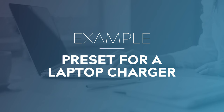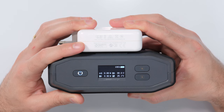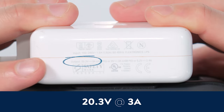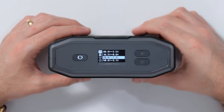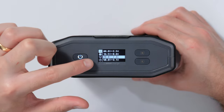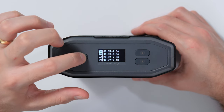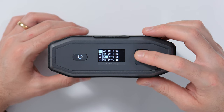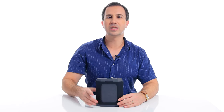Let's say that you have a laptop that you want to set your output for. The first thing you'll need to do is grab your laptop's charger and check the output voltage and output amperage of that charger. Here I've got a MacBook Pro charger. The output voltage of this charger is 20.3 volts at three amps, so we're going to set up one of these presets to match that. I'm going to choose the third preset because that one is the closest to my desired value. To make a change to the value, hover over the preset and press and hold the power button until the voltage value is highlighted. Then use the up and down buttons to select your voltage — we want 20.3 volts. These battery banks are very precise and you can change their values in increments of one decimal point.